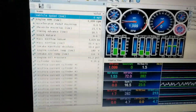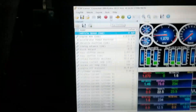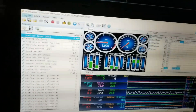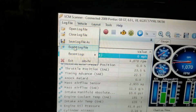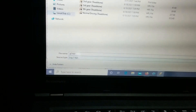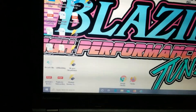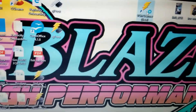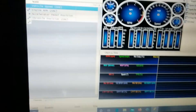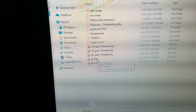After you're done scanning, simply click 'Stop Scanning.' Once you stop, you can save this log. Go to 'Log File,' then 'Save Log File As,' and put it on your desktop. We're just going to name it 'G8 Test.' This is a log file, not a tune file. Save that, and now you have saved the log you just made.